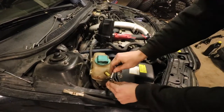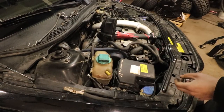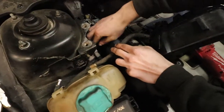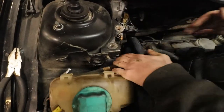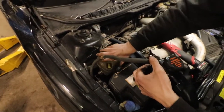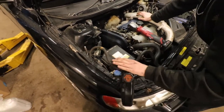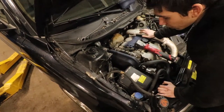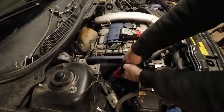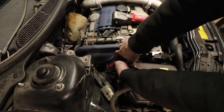For stuff like this that's temporary, just stick a bolt in it so nothing leaks. This is the level sensor plug right here, so we want to unplug that to get more room. This could go underneath here — it's fine to stay over there, it won't hurt anything. Then we have access to the next step. There's a single 10mm in the middle of this cover — take that off. Feel around until you find the hole.